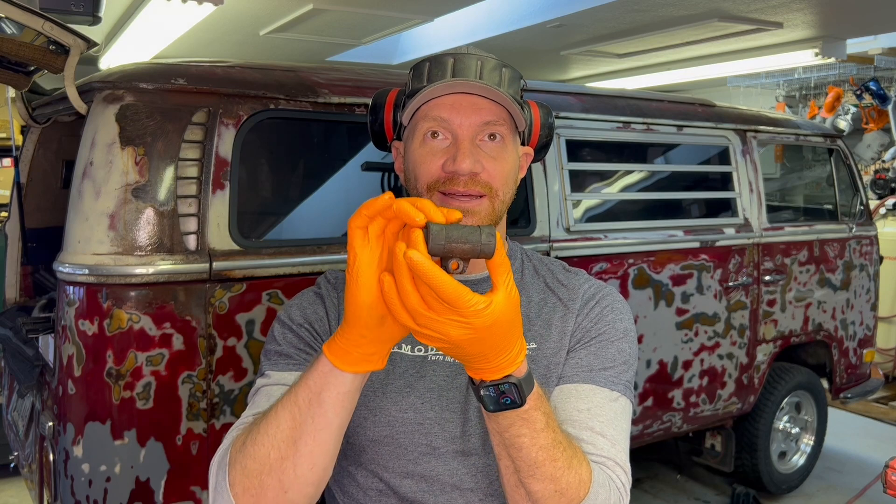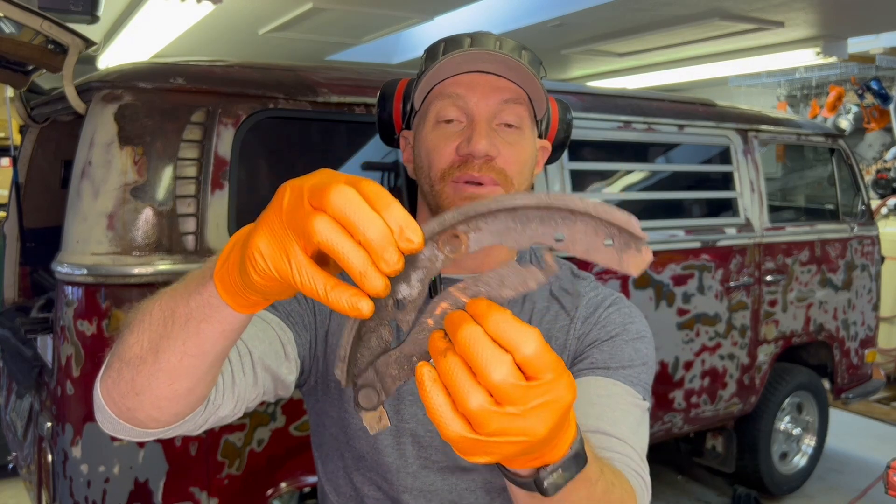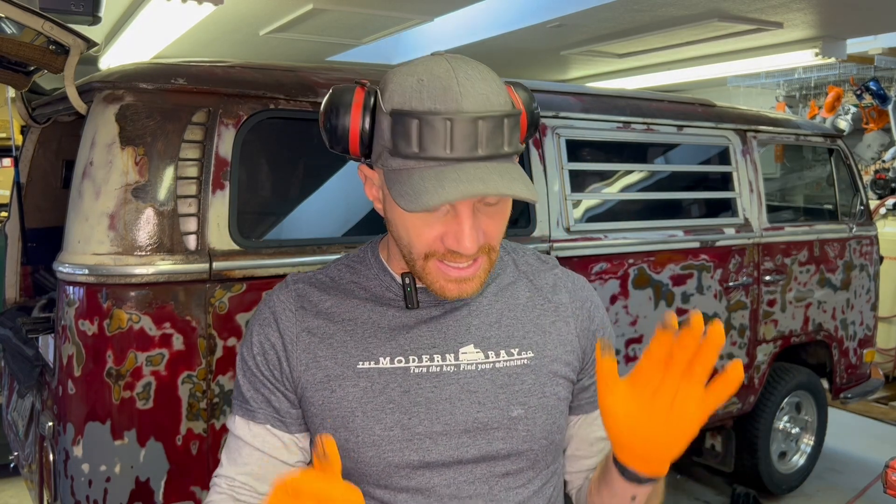The wheel cylinder pushes out at the top, pushing on the brake shoes and pressing them against the brake drum, allowing your brakes to actually work. What happens — and you can see this when you get your wheel off and your brake drum off — is you just want to pry up the bottom of one of these little cups on the end. As you can see, this one has brake fluid in there. You never want to see that. If you see brake fluid only in that little cup but not on your brake shoes, you caught it in time and maybe can get away with just replacing the wheel cylinder. But often that seal has popped and your entire braking system under the drum is just coated, soaked with brake fluid and no longer working. At that point you have to redo everything.